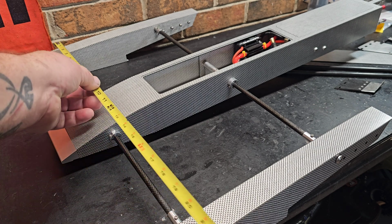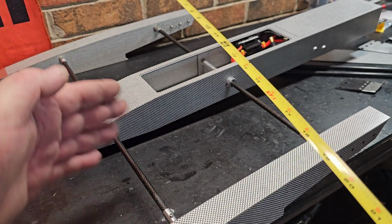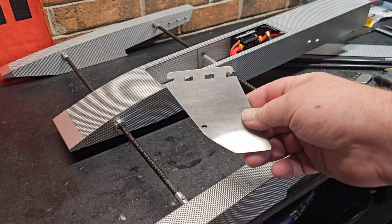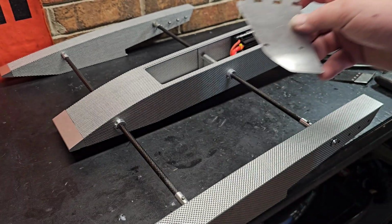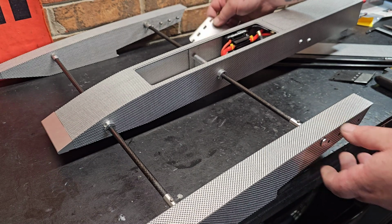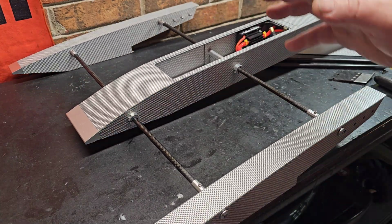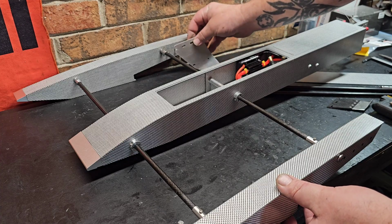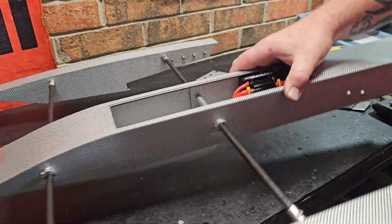Okay, so out of the box, this rigger actually comes with like a 22.5-inch stance. The sponsons wouldn't even fit on my table. So with my riggers, what I've experienced anyway, a decent turn fin, or even a small turn fin, the drag, the resistance of the boat running with that turn fin in the water, it will actually cause the boat to veer when you get on the throttle. Also the prop wanting to work against that turn fin, it's prop walking and veering kind of at the same time. So when you get on the throttle, she's wanting to really skirt out, so to speak, real hard.